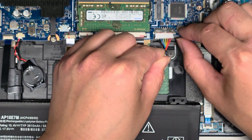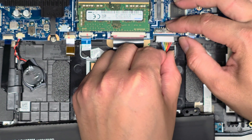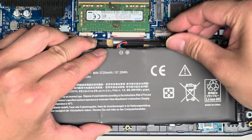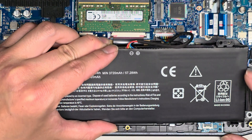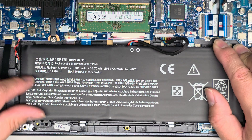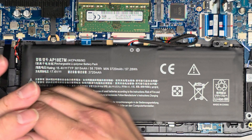We're going to go ahead and plug the new battery in. Line the connector up — again, make sure the black wires are going this way and the red are going that way. Pinch the two together and make sure it goes in straight. Once that's in, guide the wire over so it curves around like the original. Slot this corner in first, get that little tab under there, lower that down, then get the other corner in, push that forward and lower that down. These two screw holes should line up, and that's pretty much it — the battery is simple to get in there.